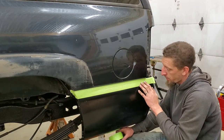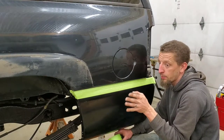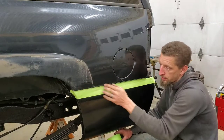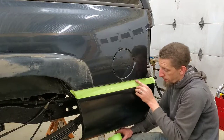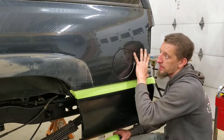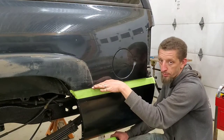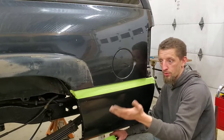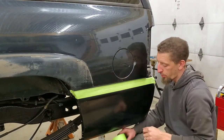So once I set up and swipe this line, basically caulk and paint make it what it ain't, because from a distance, the light will reflect on this panel and will catch on the roll of this seam, which will take your eye away from the actual repair. The reason being is I did not want to get involved in blending this out. My goal is to repair the quarter and paint from the seam down, blending at the seam and making it so your eye doesn't catch it. So you have to use the reflection in the body seam to help with that.